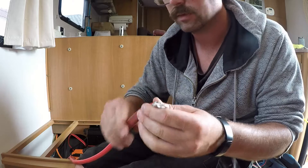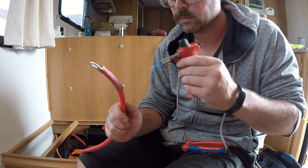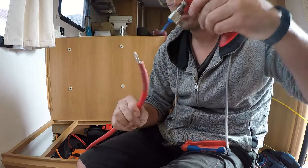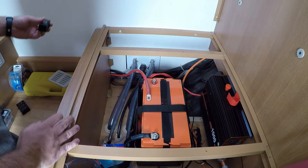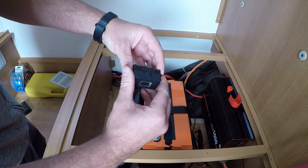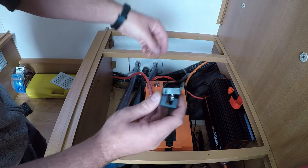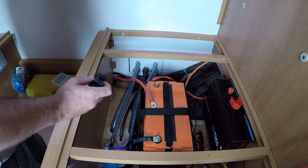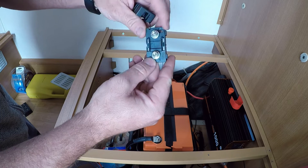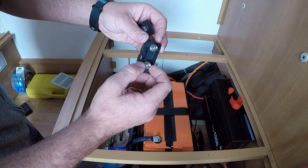Nice solid connection. Once your heat shrink comes on, that's the finished product — look at that. Beautiful. For this install I'm using some midi fuse mini fuse boxes. These are neat — they give you 6mm post terminals with a little cover. If you're using big cable like the 2 gauge here, you just have to trim out the outside to get around the terminal lug. You get a nice block you can screw to a panel, and then the fuse sits in there with your terminations. That's sitting in nice, cable running down in there.